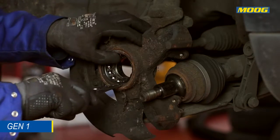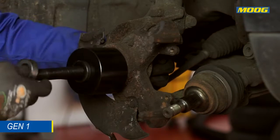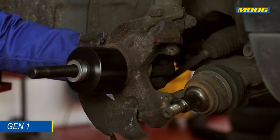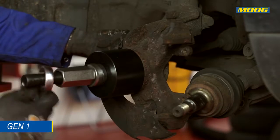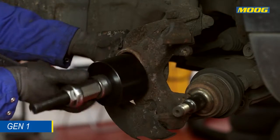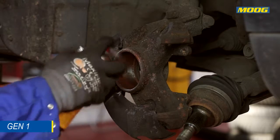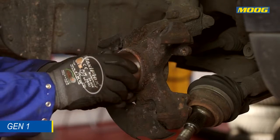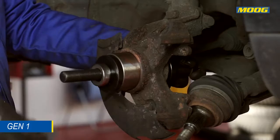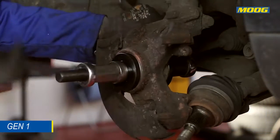Clean the spindle and check it for wear and damages. Clean the steering knuckle and the bearing contact surface of the hub to remove rust and dirt, and apply a layer of anti-fretting spray or paste to the inside of the steering knuckle and the bearing contact surface of the hub. Press the bearing straight into the bushing by using an appropriate tool. Pressure should only be applied to the outer ring of the bearing, as failure to observe this rule will cause serious damage to the bearing.